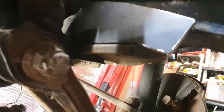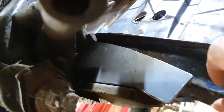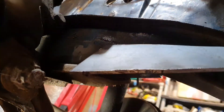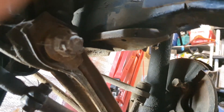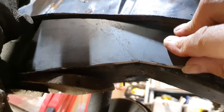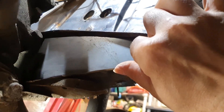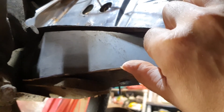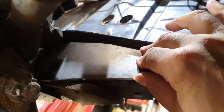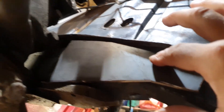This is option B that I started but then abandoned - I thought it was a good idea to go straight on the frame rails. This is my original plan which I abandoned, so we'll call this Plan B. I've got some five mil plate steel - I'd have to drop the subframe to do this method. I've made these extra brackets I was going to bolt in, but I think you'd end up squashing the box section if you clamp them in, since there's no real structure inside the box frame. So I'm thinking if I drop the subframe I'll weld these in place as a reinforcing plate.